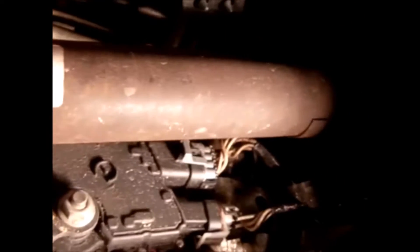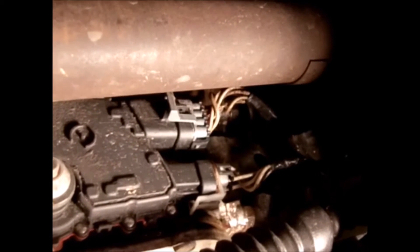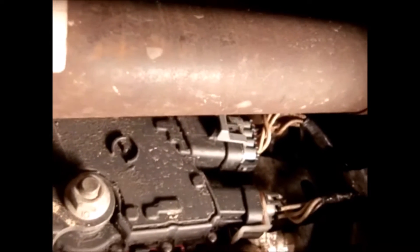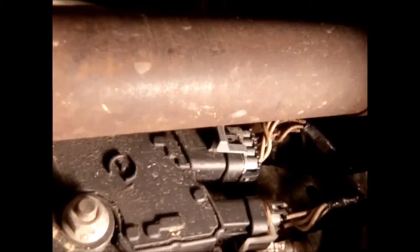The reason the connectors are so hard to remove is that from the factory they put some kind of epoxy or glue in them. If you just try to pull them off or pry with a screwdriver, you'll bust them. What you want to do is get a heat gun, set it on low, and slowly go over these two connectors. Don't get them too hot because the plastic melts easily. Heat them until the resin just starts to loosen, and you'll feel the glue turn into a thick runny paste — then you can just pull them off.